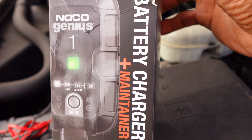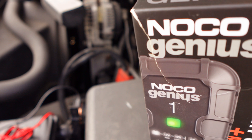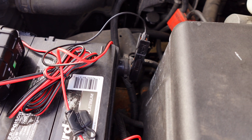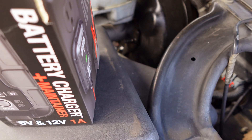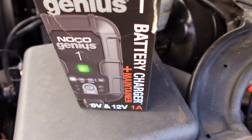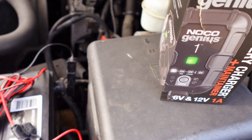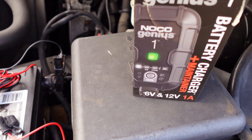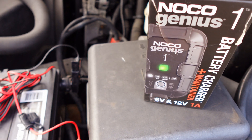Even if your battery is kind of dead, you can plug it in and get a quick boost to be able to start your car. If you jump-start your car regularly but still don't drive it every day, that battery still has a chance of running down — that's where this comes in. It will fully charge your battery versus just jump-starting it. With a jump start, you go to the store, come back and your battery is dead again because you need at least 45 minutes of continuous driving at 55 miles an hour or so to charge the battery back up.